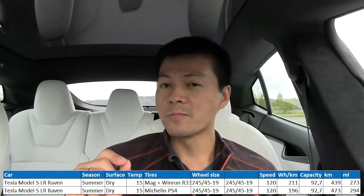So based on this, we can assume that the slipstream rims actually give you better consumption than these non-aerodynamic rims. And it seems like the lower weight on these rims doesn't help at all. In theory, it shouldn't help because we are just driving constantly. If we did a city run with start and stop, that could have been different because it would be slower speed and more acceleration and deceleration. But for highway, it doesn't matter at all, these light rims.